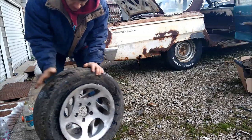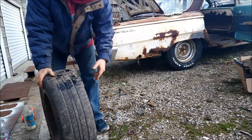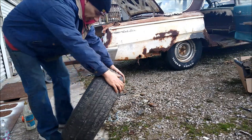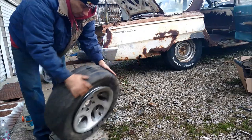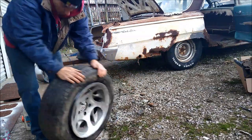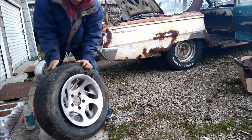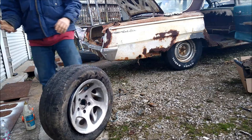And you're on. Now this tire's wide compared to the rim, so it pushes out to seat. It shouldn't be any problem to just put air to it and seat it to the bead. Sometimes if the rim is wider than the tire is naturally, I'll hold it with the front facing out, put my foot in and push, and with that oil in there you can seat the bead at least halfway around, sometimes more. Then you'll have a gap out front, so you lean the tire down like this and push that back in there. Make sure that valve stem is tucked behind the tire bead. Then you can start putting air in and it'll fill up.